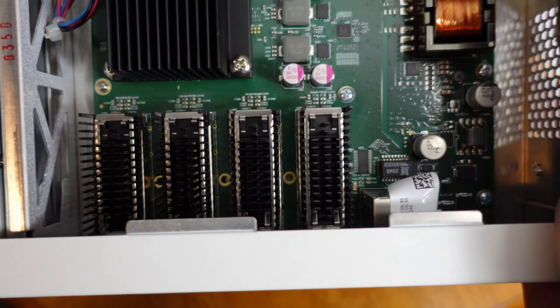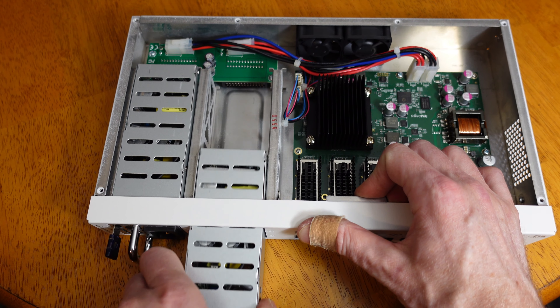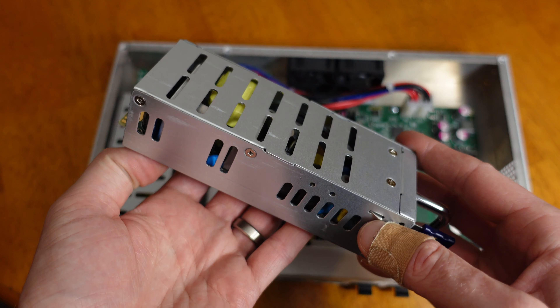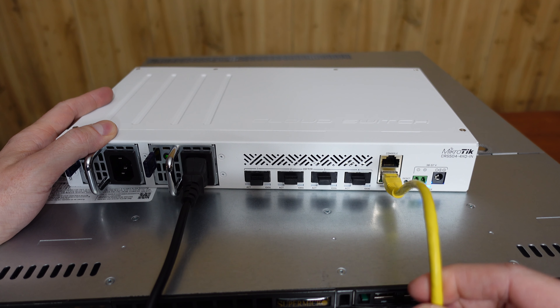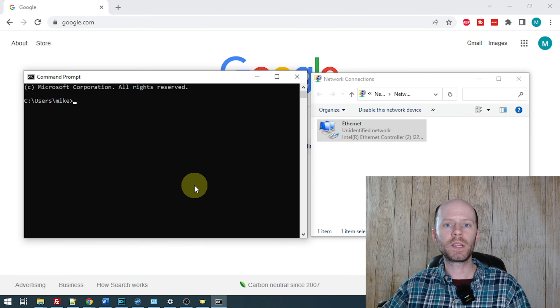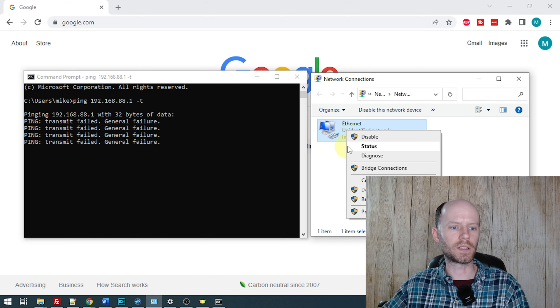There's not too much to see under the lid. You can see our two power supplies here. The power output from both comes into the main board separated — power supply 1 and power supply 2 — then they are combined on this board. We see both of our fans here, blowing towards the back of the case. We've got a rather large heatsink on our processor, and heatsinks on the QSFP28 cages as well for some added cooling. These are 12-volt, 5-amp power supplies — they're kind of tiny compared to Supermicro and Dell PowerEdge power supplies.